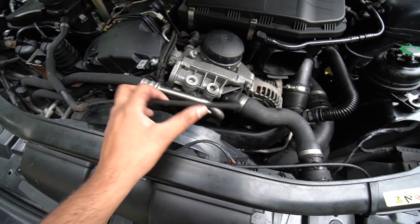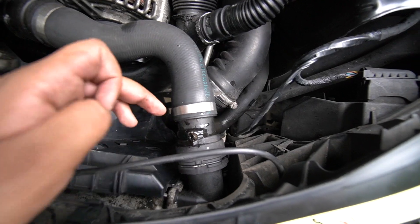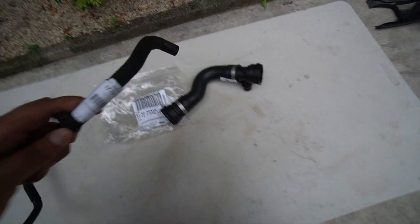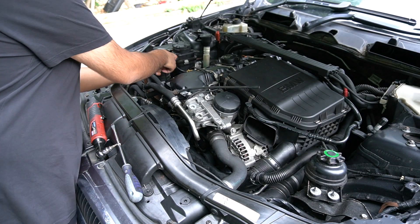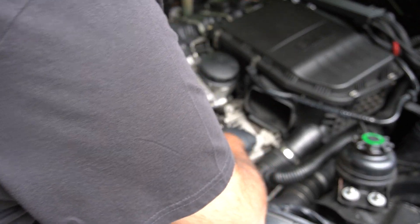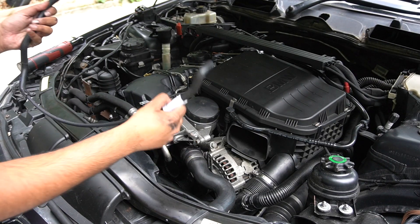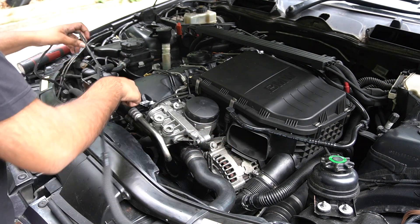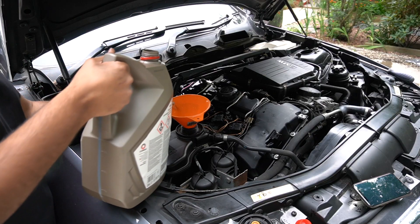Initially I thought I'd just buy this pipe, which I did on the day, but then when putting the fan back in, this pipe broke. It has a little hook that goes upwards - you can see how it should be, and there's the end which is going to hook on. Let's pull this pipe off - already loosened it. Taking off this pipe, we're probably going to get coolant everywhere. Yeah, loads of coolant - what a mess. Right, so that coolant pipe's in, next we're going to do the one from the expansion tank.